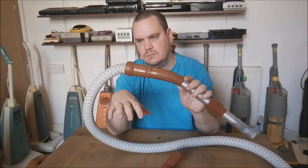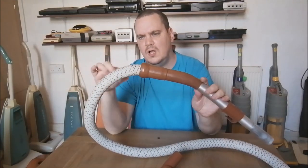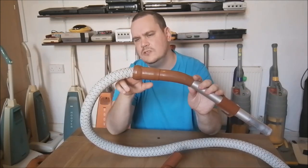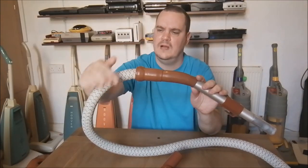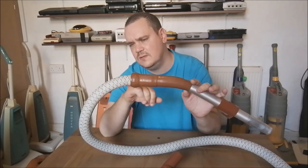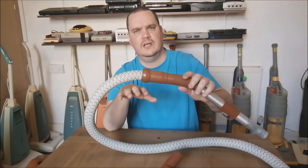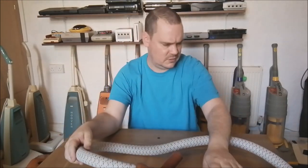It's fine, it's functional, but in being completely honest with you, I just want to tell you everything about this cleaner. So what I would say, and I'll put this in the auction listing as well, is if you wanted to make this last a bit longer, put a couple of wraps, about an inch to an inch and a half, of PVC electrical tape around this. That will give it a bit more seal at that point, and it'll add some strength as well. It's still held in place. This is not going to break away or break off. You're not going to be left holding a bent end with your hose. But it will gradually, over time, with more use, start to get worse. So just put some tape around that to give it a bit more strength.